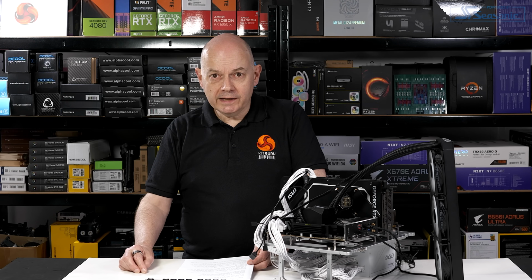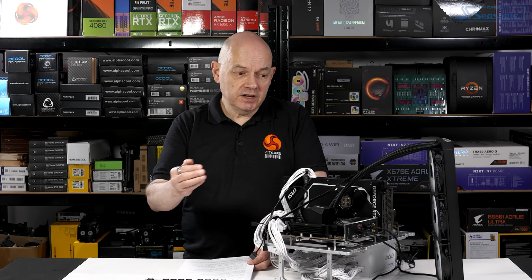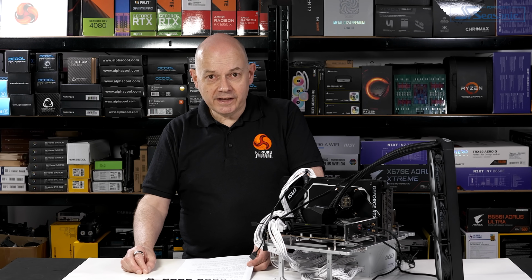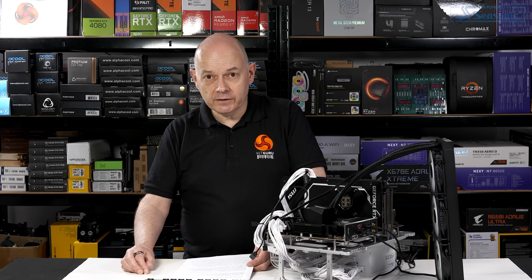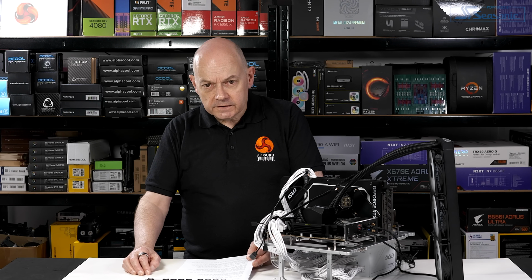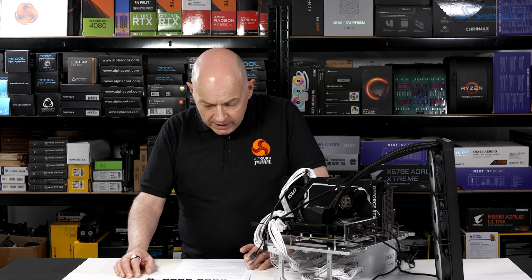And when we're talking about a level playing field, we need to consider memory. You need to be aware what reviewers are using. So this is DDR5 8200 CUDIMMs. DDR5 8000 I think will be quite common on this platform. AMD Zen 5 can also run DDR5 8000. However, Zen 4 processors may be running on DDR5 6000. Obviously older platforms use DDR4. So you just want to be clear about these things so you know what people are talking about.